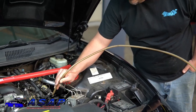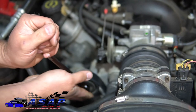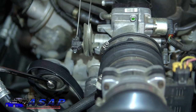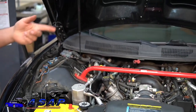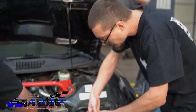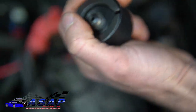Not a lot of capacity in those reservoirs. We got our fluid out. Next, we're going to go ahead and take our belt loose, since we're pulling that pulley off. You just want to come over here a little bit and slide it off the water pump to give enough slack. We'll leave that resting there and get the belt out of the way, and Nick's going to work on pulling that pulley off.